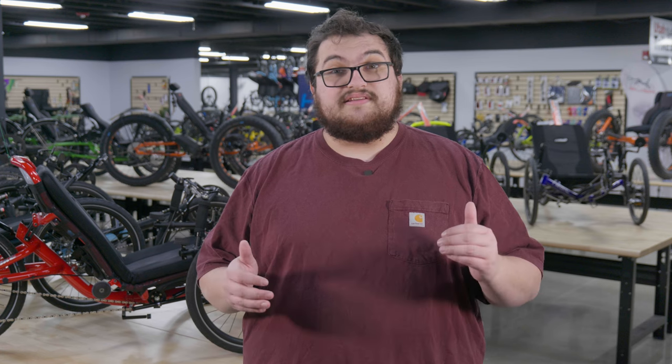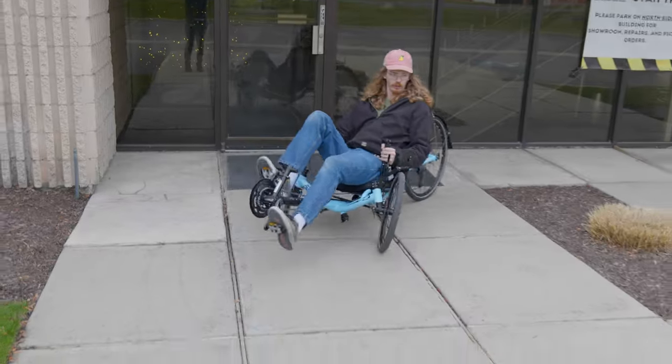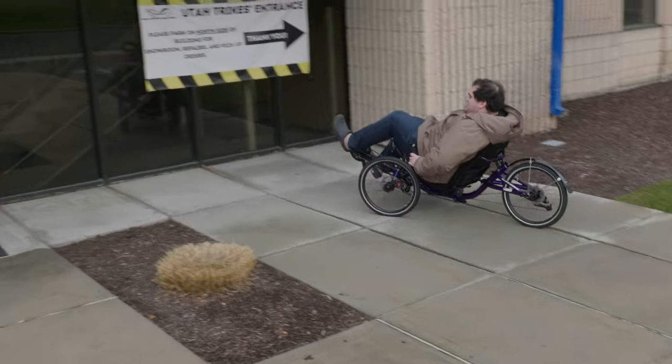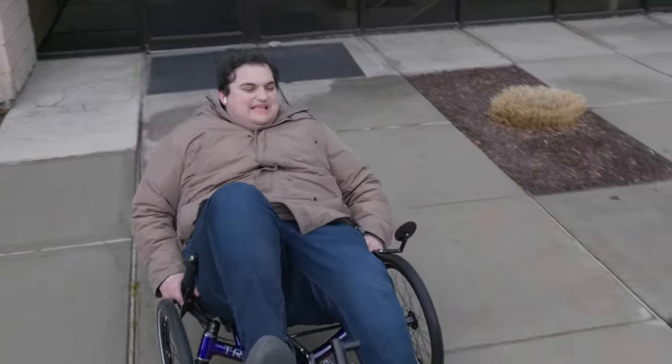In the simplest terms, a larger wheelbase means a larger turning radius, and a larger turning radius means you're going to have to take wide turns. For most trike riders, it's understood that you're already going to have a larger turning radius than on a bike, but you can factor that in when you're riding. The 559 has a turning radius of 9 feet, which is very wide and makes cornering difficult. In comparison, the Trail has a turning radius of 8.25 feet — still fairly wide, but it should make cornering a lot better than the 559.